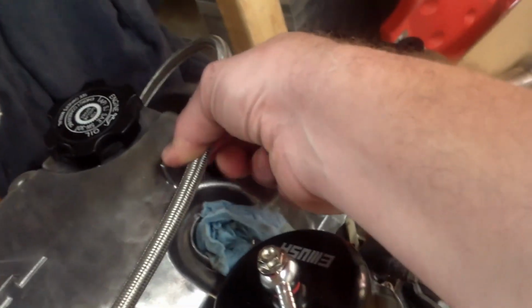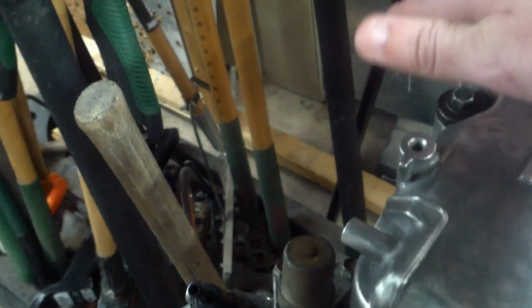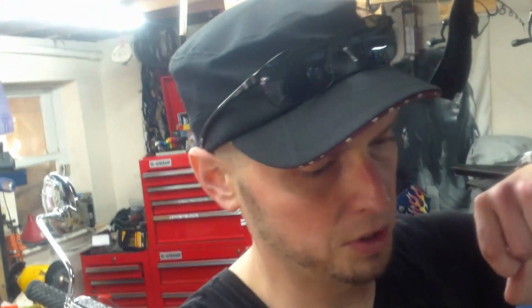Yeah, I don't have new plugs yet. They're on the way. They should be here tomorrow. I just need to get a P-clip to hold this up out of the way. Notice there's no intake manifold on it or distributor. I'm taking that off of the old engine because the distributor I put on the engine is brand new. And as you guys know, I have a Skunk 2 intake manifold and throttle body that's going to be going on here also. With that being said, I talked to the tuner this week, and he's about 2 weeks out.